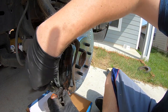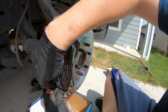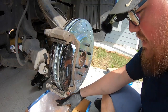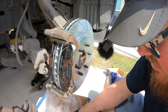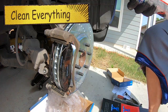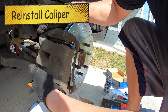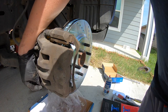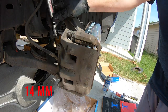Then you have these little brackets that you put in — one on the top and one on the bottom — and they help separate the brake pad from hitting the rotor as it spins. I only pulled one off, and this is an aftermarket style kit, so the original may only have had one. You do want those to go in flat, so you might have to do a little wiggling. From what I can tell there was only one, even though there's a spot for one on the top and bottom. Now spray everything down one more time with brake cleaner. Once your caliper is on, you may have to push in on the bolts on the top and bottom. Put them in by hand first to make sure you're not cross threading them, then tighten down to 26 foot pounds of torque with a 14 millimeter.